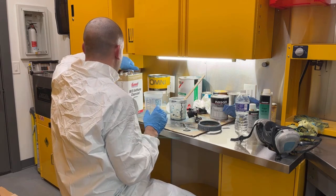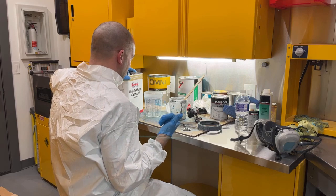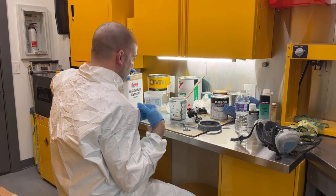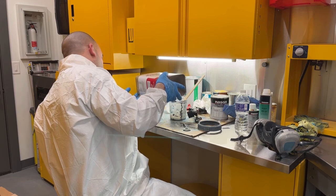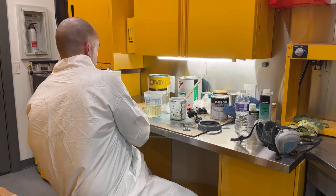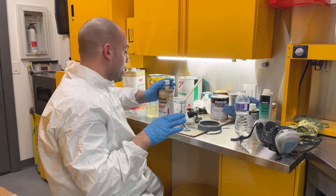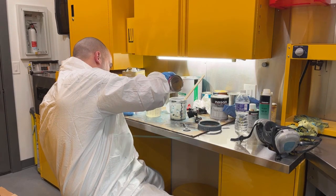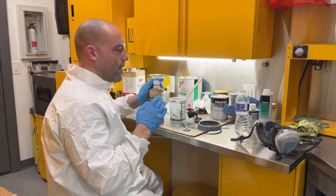So what I'm going to do now is, I have 3 more coats of clear to put on. I have 1 more on the quarters and the back tail pan, and then 2 more overall, including the front and everything. I'm not going to videotape this next coat, but after that I'll probably videotape the 3rd coat, and then I'll finish up on the 4th. Now with this car and those fins, it is really hard to not get a run in those fins. I'm trying my absolute best not to run that. Problem is, you've got to have a happy medium.